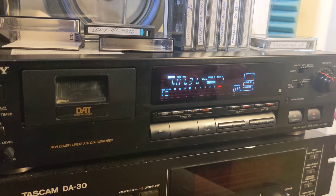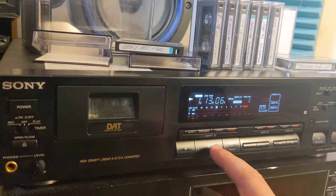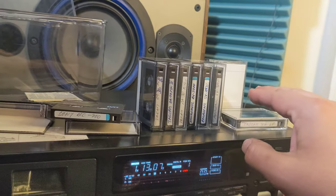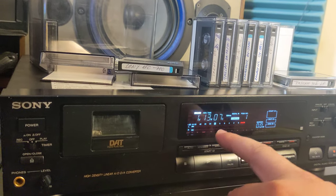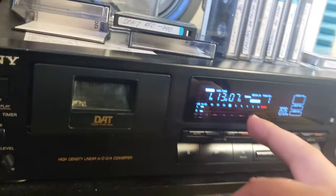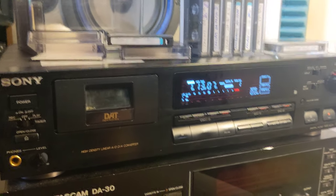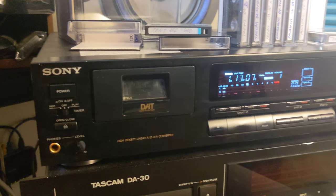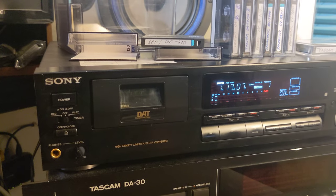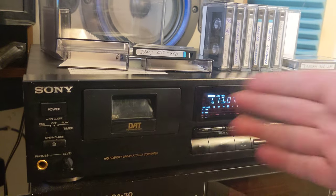This is a low-budget fix situation. Most people who want to use this device and have a lot of DAT tapes would like to transfer those tapes to a computer. If they have a sound card with a digital input, they would connect it via the optical digital output on the deck to the input on their computer and record in software like Audacity, Sound Forge, or whatever you use — on Apple computers too — and transfer all those tapes, then do whatever they want with them.